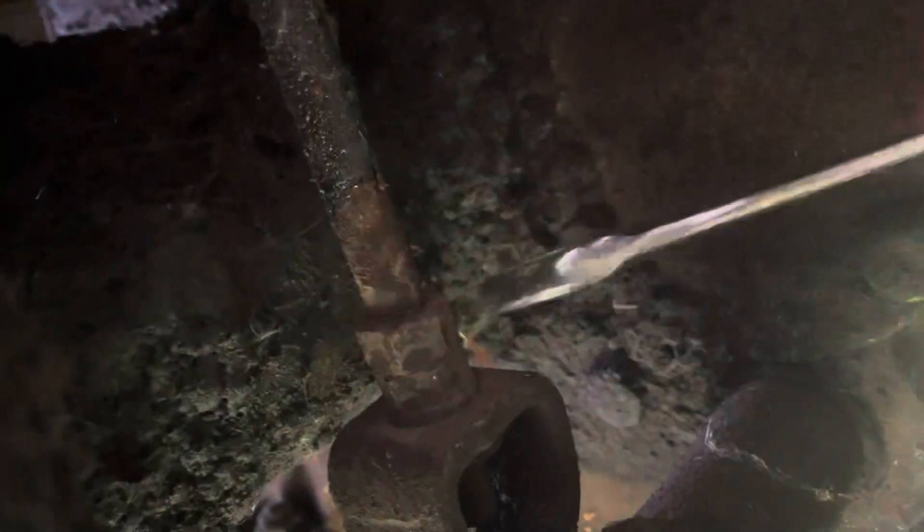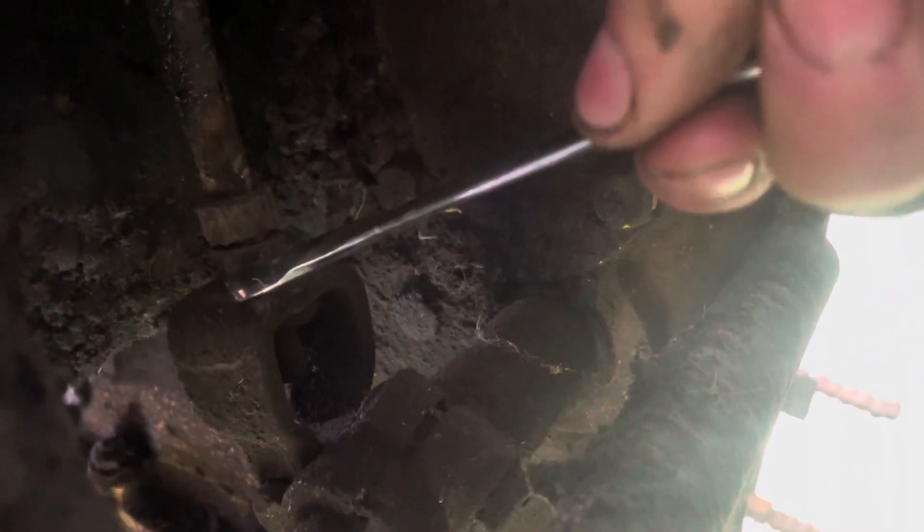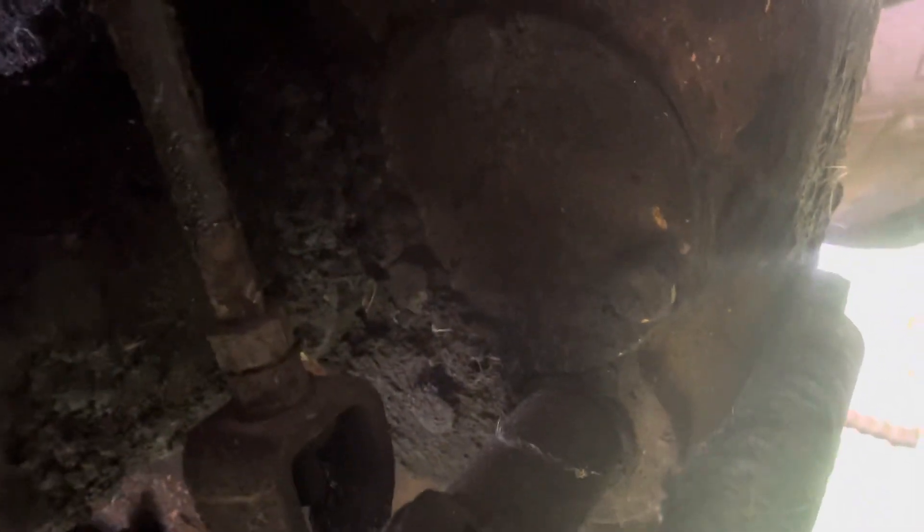So you've got two nuts on this rod that goes into the back axle. What you want to do is undo the locking nut. And then if you want the brakes to come on more, you've then got to wind the nut closer to the axle. You've got to do this bit by bit, keep on testing the pedal.